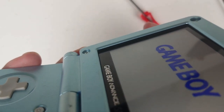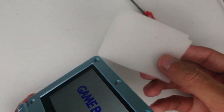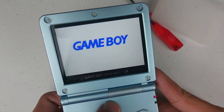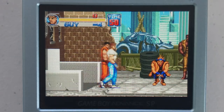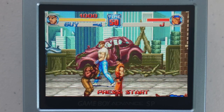As you can see, there's a gap on the side of the screen because I didn't use that foam pad, so make sure you use it and don't make the same mistake that I made. Back to the screen — it has five different levels of brightness, which can be adjusted by the brightness button. It has a resolution of 480 by 320, which is integer scaling, so it has a proper 3 by 2 aspect ratio.